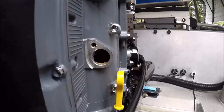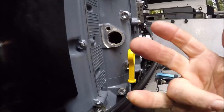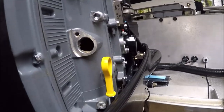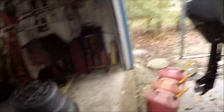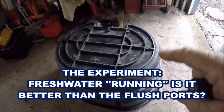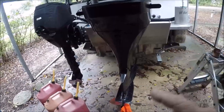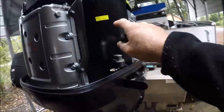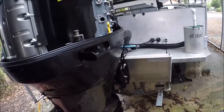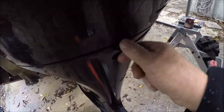I also have notes up here about water pump, gear oil, and oil change. Here is what it looks like after September, October, November, and December — about three and a half months, not a full four months. There's my barrel, a 70-gallon Rubbermaid commercial horse trough barrel. Every single day when I come home since September I've been putting it in the barrel and flushing it out with the engine running.